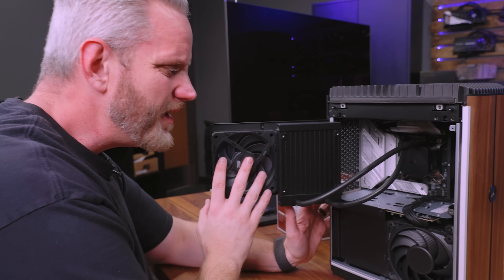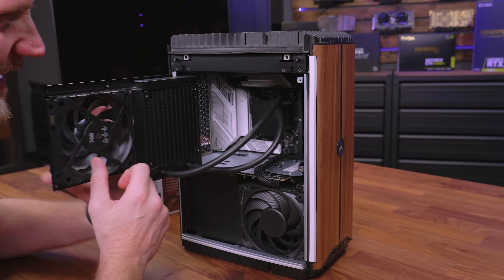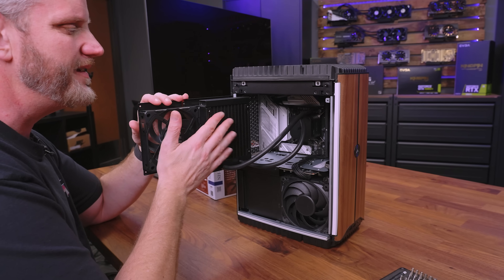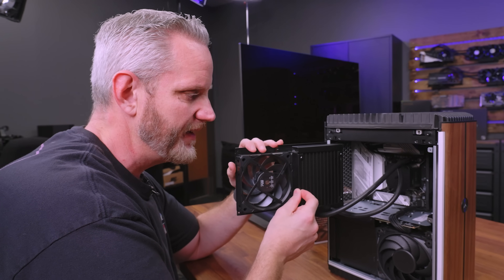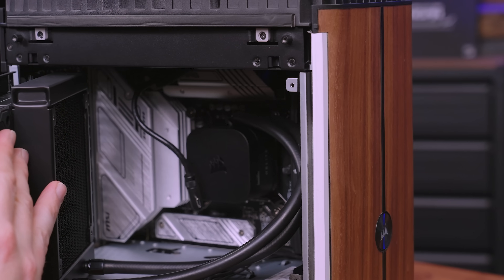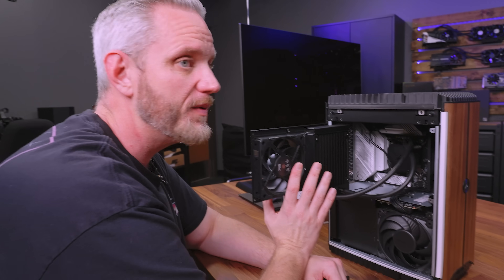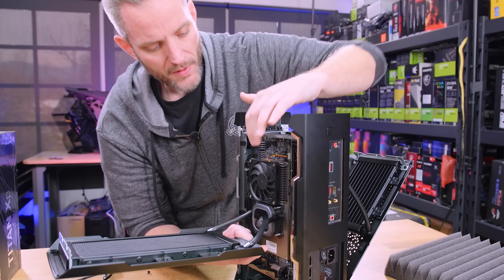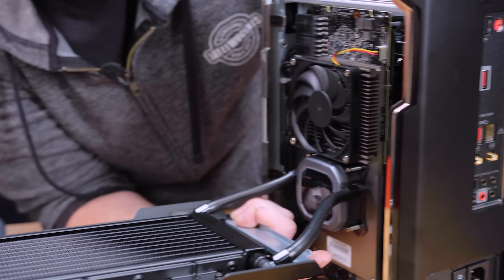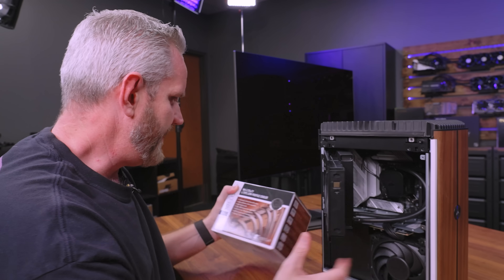If you haven't seen our other videos, this is the new Corsair One i500, which has a 14900K, a 4090, and this little 120mm AIO trying to keep a 14900K cool — which is not going to work. This is based off an H60X. If they had made it even an inch wider they could have fit a 240. The older Corsair One models had lower TDP CPUs but a bigger, nearly 240mm bespoke radiator design.